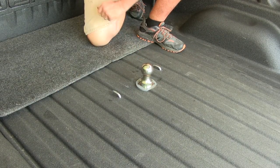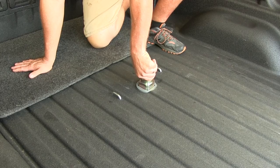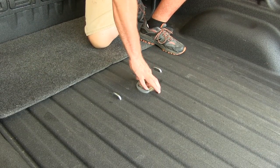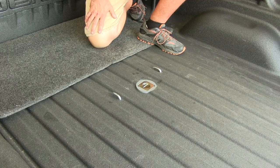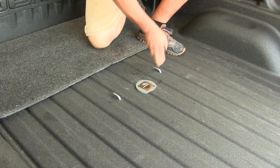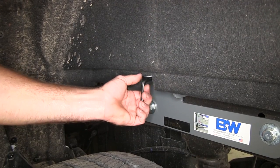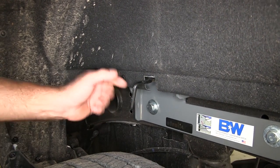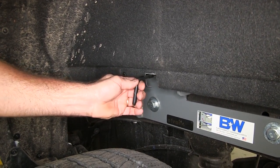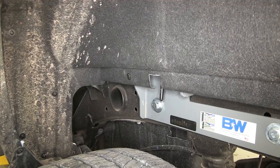Here's what it's going to look like once it's installed. We can pull the pin from the driver's side fender well and pull the ball up. We can flip it over, drop it back down, and stow it away. It's also got these spring-loaded safety chain hold downs, so when they're not in use it's going to be pretty flush to the floor. When you want to flip over your ball, just pull out and pull it to the front — that locks it in the open position. Once you flip the ball over, just pull out, push it to the back, and release it, and that locks the ball back into position.